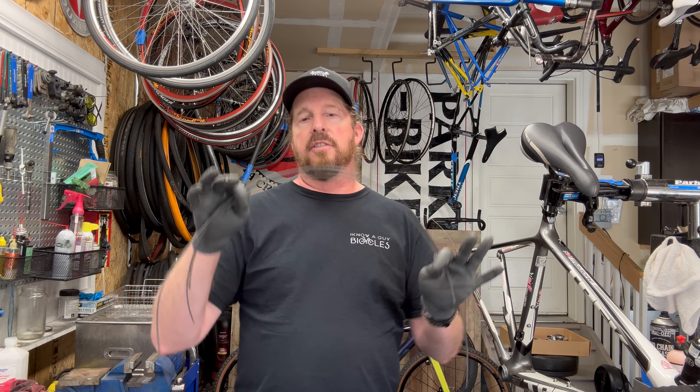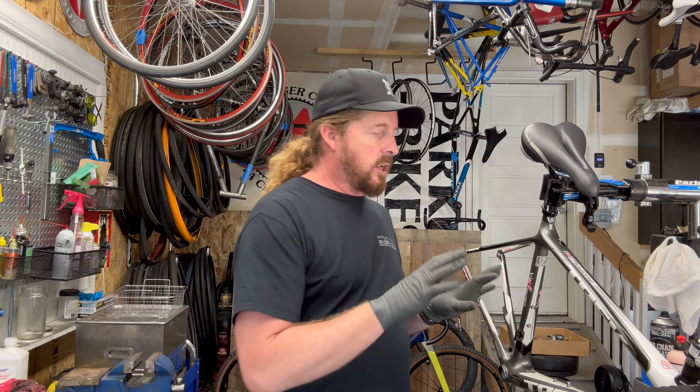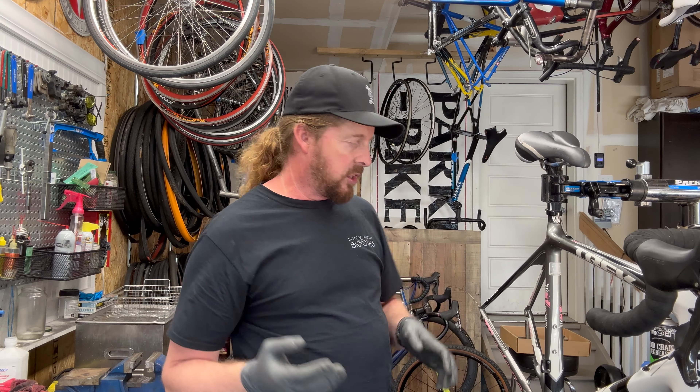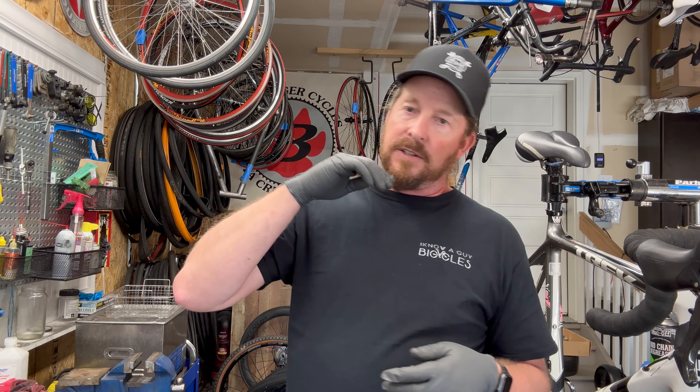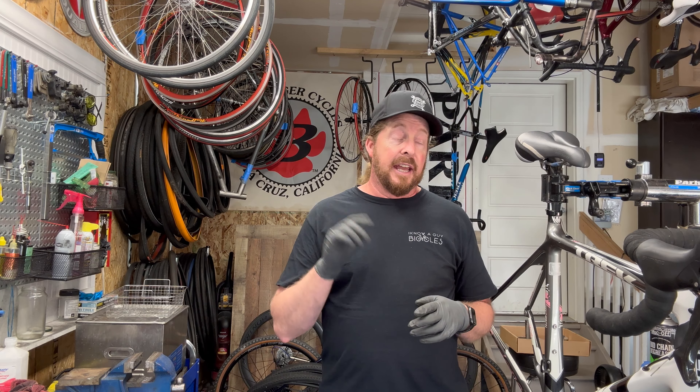Take your regular brake cable or housing — something that's not on the bike, like something left over, or possibly go to your bike shop — and take that cable to the hardware store and try to get a plastic sleeve that fits like so. I'll try to find some on Amazon and put a link below if I do. I have three that are the same diameter, a couple of different lengths. This one is a little tricky because I have a sleeve that goes through here, then it has a bottom cap, then a sleeve that goes up to the front derailleur cables up front, and then I have a brake one. This is all internal cable routing. Park Tool does make a tool kit to help with those. I have not played with one yet — at some point I will be able to afford one. I don't usually go through this too much, and I already have the sleeves.